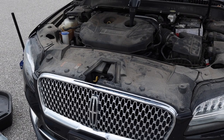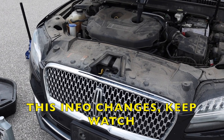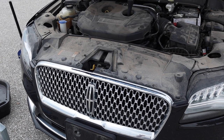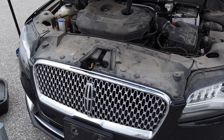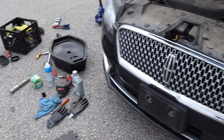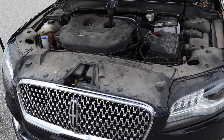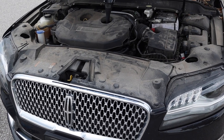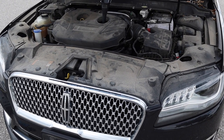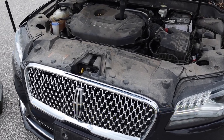I kept cycling the engine, letting the oil settle, checking. 5.4 is not enough. This car took about 5.8 liters to get it up to about 3/4 of the way to 7/8 on the hash marks for the dipstick. So I'm going to run it one more time and check it again, but I'm not going to put in the full 6 liters. It's just under 6 liters, those two Mobil 1 containers. But I want to make sure the car has enough oil so the turbo isn't starved. And at this point, the oil filter is completely filled with the amount of cycling I've done. So I'll check it one more time, but use a dipstick, people. I don't know, the AMSOIL site is not as trustworthy as the dipstick, for me at least.